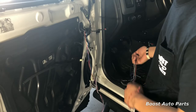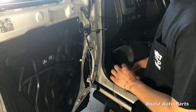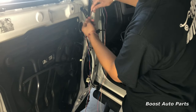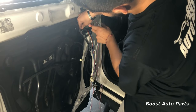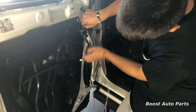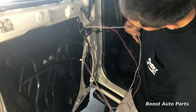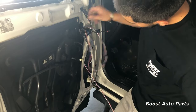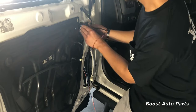Now we're going to take our wires from the grommet down through the speaker hole — run those straight down and grab them with your other hand. We're doing all of this with the window down to make sure all of our wires will be clear of the window track. Pull all the slack through, making sure that you do not let the wires chafe on the metal as they come down. Then we'll go ahead and tuck our rubber grommet back in.